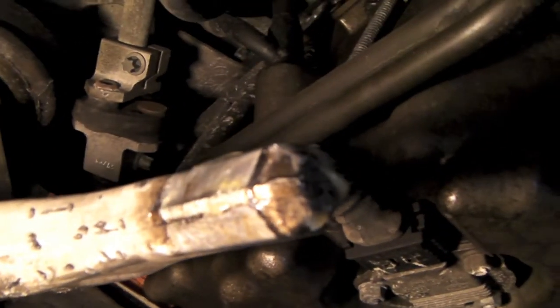Once that was greased up and grinded a little bit, I just hammered the metal core onto the new control arm. Try not to hit the aluminum part or the rubber, because then you bust the bushing and it's basically ruined.